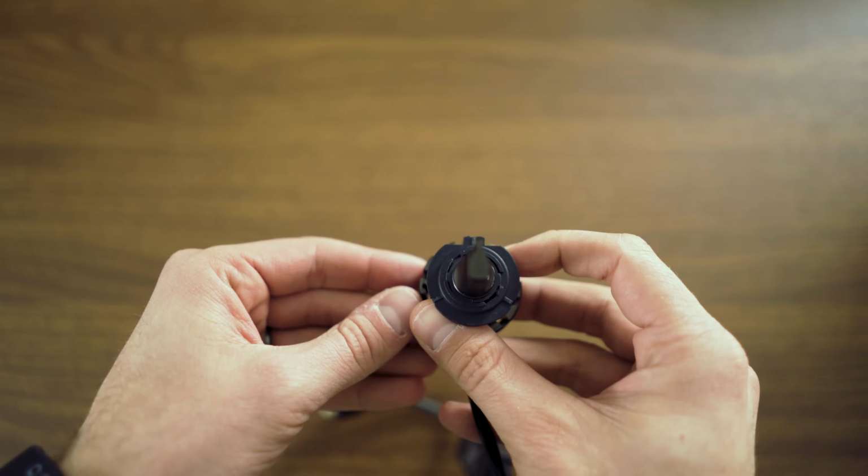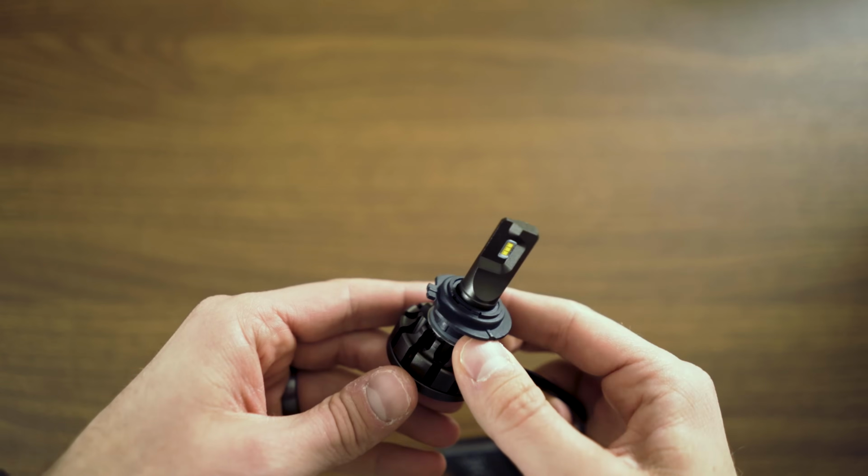And what makes this so special is the cutout where the light beam is actually facing towards. One side's larger, one side's smaller, and it's going to concentrate that light beam with no oncoming driver glare. Whereas the COUGAR motor LED kit did a pretty poor job and scatters light really everywhere in a reflector with almost no hot spot. This kit had the best beam of all of the kits that we've tested, really. And it's again because of this design.